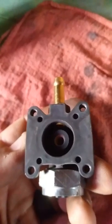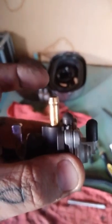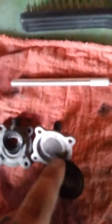This is how these go together: the diaphragm goes on this one and fits into a groove on the backside. Then this one you're going to sit in - you see how this one's pushed out? You want that pushed-out part to go down. You don't want it to feed into the back of that hole at all; you want that hole to be as open as possible. Put the gaskets into place, then put it back together. Your fuel line will still be able to slip on even though that little nub is there. Before you pull this back together, leave it open and let it sit overnight - let this really cure up. That way when you put fuel through it, it's going to be locked onto these parts and fuel can't get underneath it.